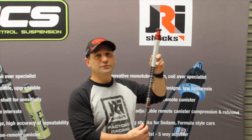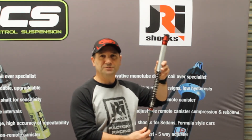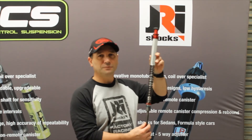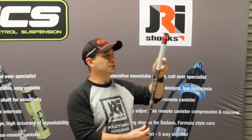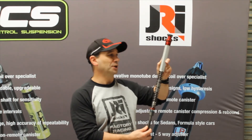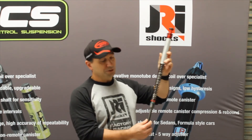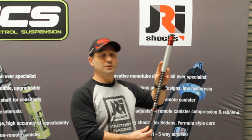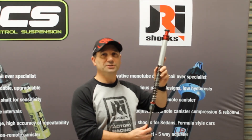In terms of low bumps, mostly bumps, and if you hit a big pothole — being a fork acting like a shock absorber, it's velocity sensitive, so it will cover both ranges quite well. It's a pretty good unit and it comes with two small bottles of oil for topping up when you install these.